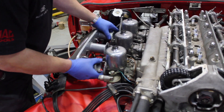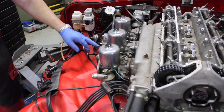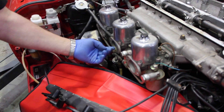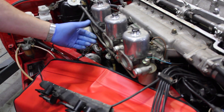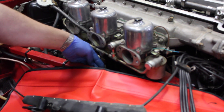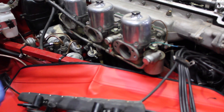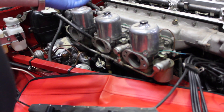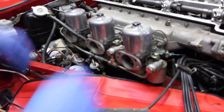Removing the air filters shows me that this carburettor is actually over-fuelling itself — fuel is coming out of the intake venturi even when the engine hasn't been running, and it is running down the fuel lines as we can see. We will have to address that fuel issue with the fuel float levels being adjusted after we've addressed the cylinder head.